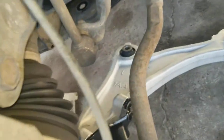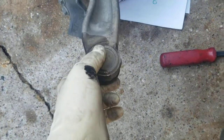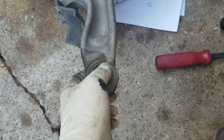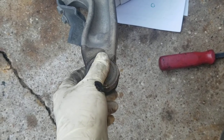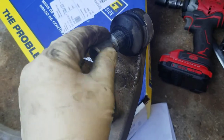The order of reassembly is just the opposite of removal. I've got the lower ball joint installed and the arm kind of swung out. The nut was facing forward — that's how the bolt came out. A lot of this stuff is aluminum, and aluminum doesn't fare well with beating on things, so be very careful. This little part here is part of the grease chamber for the lower ball joint, so if you hit it there it's going to collapse and damage it. It goes together easy if you have the pinch part of that spindle spread out a little bit, and I put a little WD-40 on there.